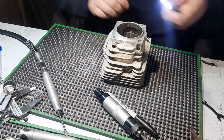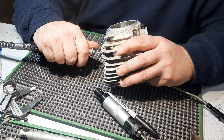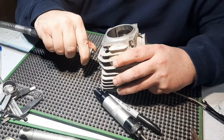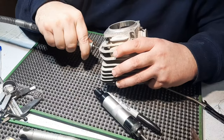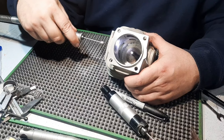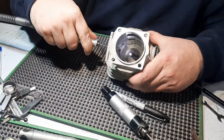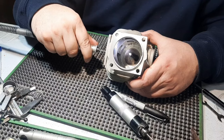Got my handy dandy light, put that in the spark plug. We'll start by raising the exhaust. Now when I do these exhaust ports, I try and work the center up first. That way I can keep a little bit of an arc to it. You work the center of the exhaust port up and then just keep rounding it to the sides.